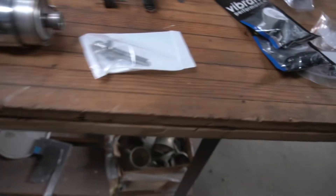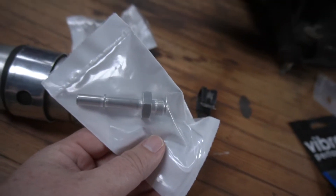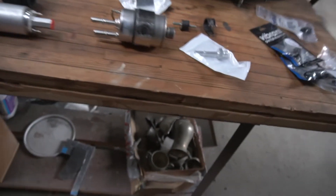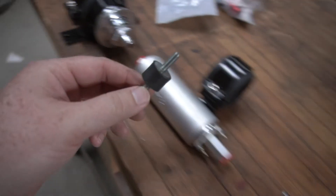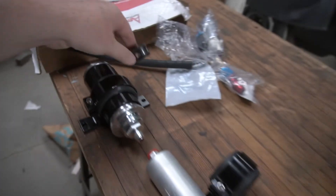That is the setup we're using on the Camaro. A couple of things that are really nice about this: you can get fittings for this that are all factory push-on fittings. This will go straight in and then I'm back to my dash six AN fitting for my line — no hose clamps, all AN fittings. I also have rubber mounts for all these components to get rid of vibration, and lots of rubber mounts to mount the fuel line to the frame.